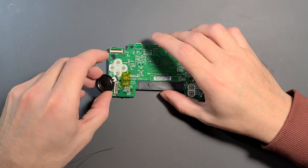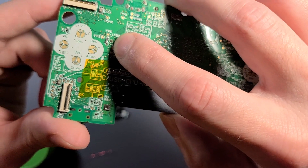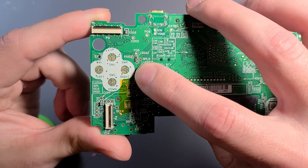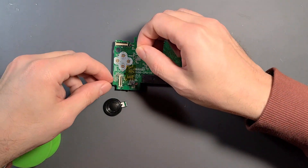This time around I'm going to go with a single speaker setup. For me, hooking up this one speaker, I'll be connecting to SPL0. You can also tap into SPR0 — that's just the left and right speakers respectively. My speaker's on the left, so I'm going to go to SPL0.